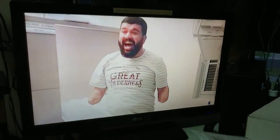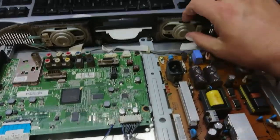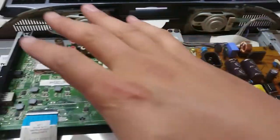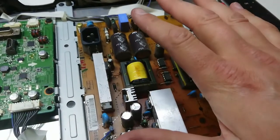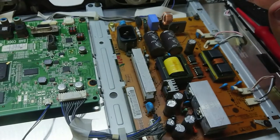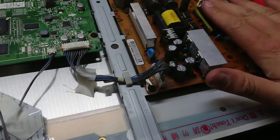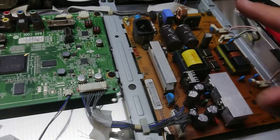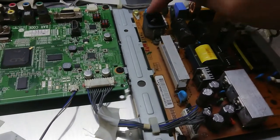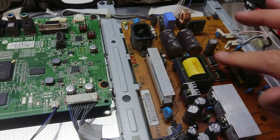The TV's working — we've got ABC here at the moment. Getting the back off, it certainly needs a clean; there's a bucketload of dust. We've got the main logic and display board, and the power supply board. The whole thing draws around 35 watts — it is fluorescent backlit. Working out the supply listing: 15 volts at 1.5 amps for the main board, and I've already tried feeding 12 volts to that board experimentally — it won't fire up until it gets to about 14.8 volts. There are also individual positive and negative 15V supplies, a push-pull system, probably for the speakers.